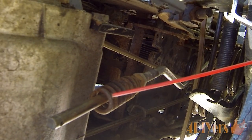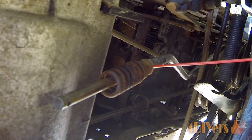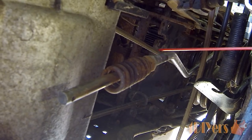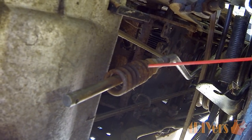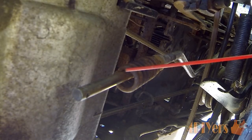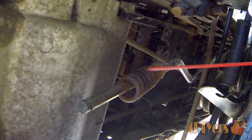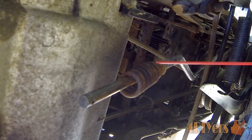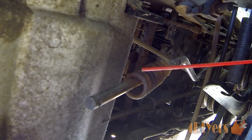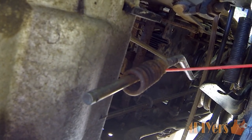As for the push rod, there is a spring on the end that goes against the lever to activate the brake assembly. There are a couple of nuts on the opposite side on a small threaded portion of the rod — this is the other adjustment. It controls activation when pressing the clutch and brake pedal. On this one I left roughly an inch and a quarter of space between the lever and the spring. The clutch activates first to release belt tension, then at about half pedal the spring touches the lever, and pushing all the way down puts the brake on full.